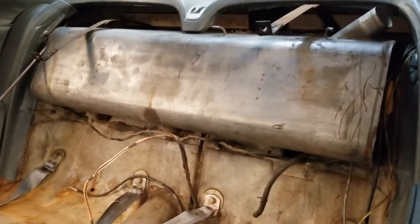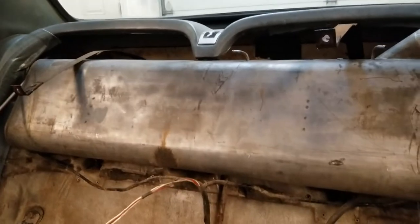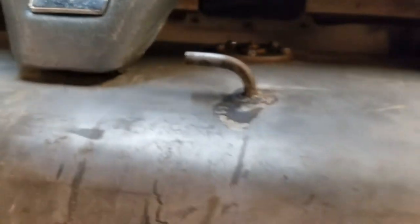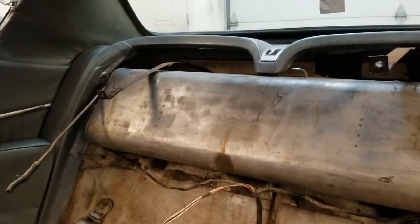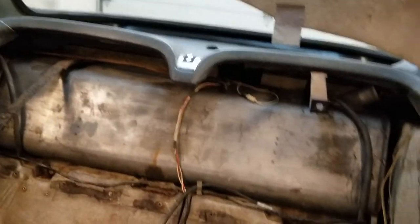It is halfway in and the word 'snug' comes to mind — getting all the vents, the return line, and the feed from the bottom in, plus all the wiring and the antenna wiring. I've got it so it'll now slide back. I get the joy of hooking up the sending unit and of course getting the vent line and the return line hooked up. I've got to get those started before I push it back, then make sure I'm not pinching any of this wiring. Once the fuel filler is on, I'll put the straps down, then crawl underneath and start hooking up the main line.